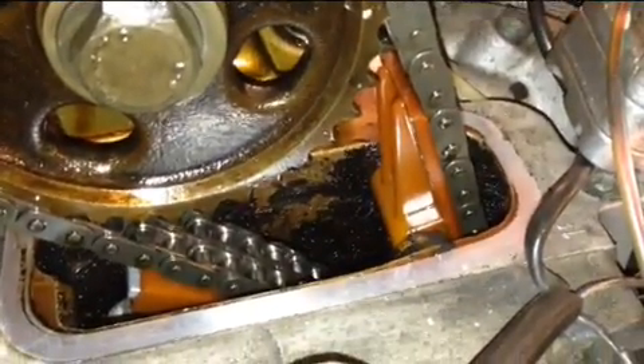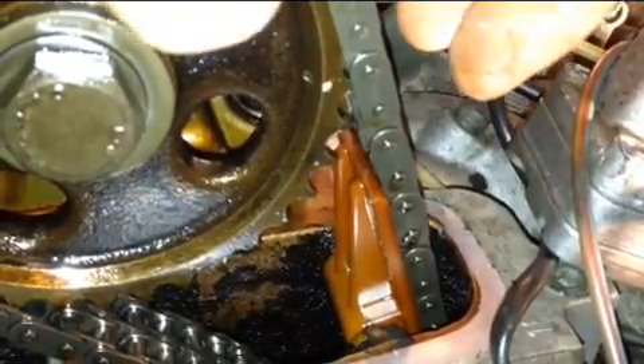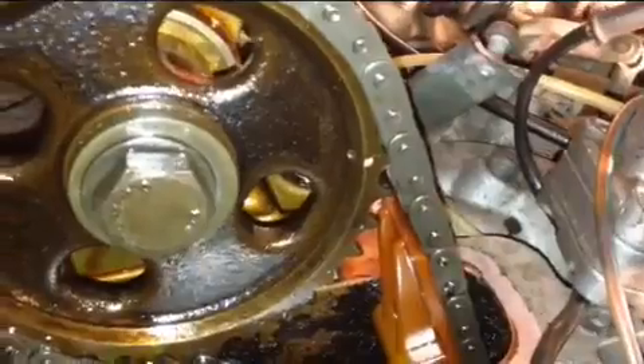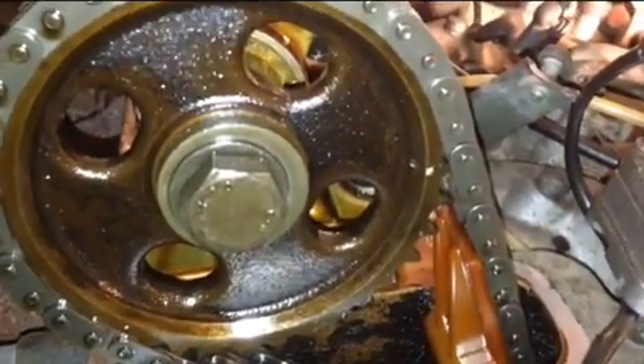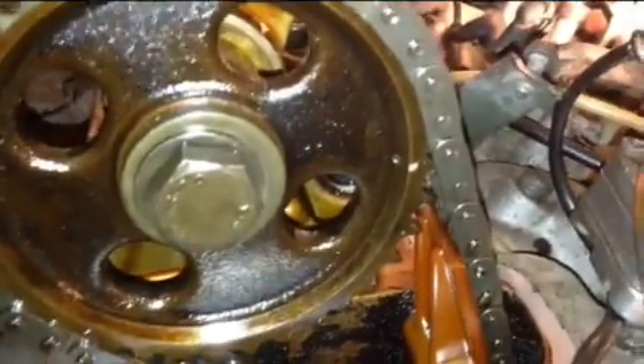That's one of the things I'm concerned about — maybe the motor just lost timing. There is a way to check it: you put the crankshaft at a certain angle and then you check the position of the camshaft, and you have to put them together at the same timing — that's how you verify the timing is right. Even while I'm waiting for parts, I'm gonna check the timing anyway. But that's it so far — just a heads up on where I'm standing with the motor.